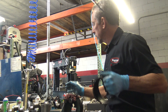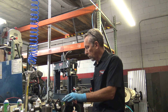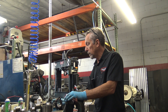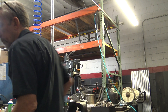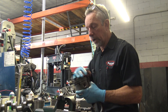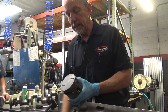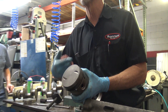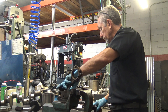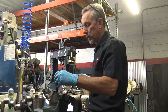You can see where the bore gets replaced. You can buy them in match sets, or you can buy a bunch of S pistons. Let me grab one — I think I know where the pistons are for this. Here's one of the original pistons, which I hope to reuse. I don't want to spend another $700 times eight. You can see it's flat top, cut out for the valve clearance, but this is a high compression engine. Let's see what the micrometer says. I'm scared.